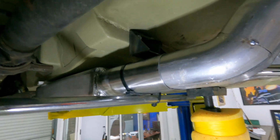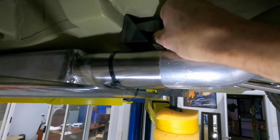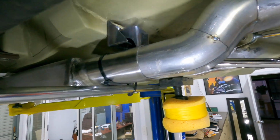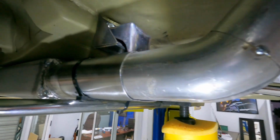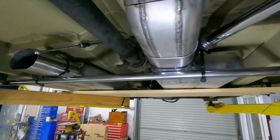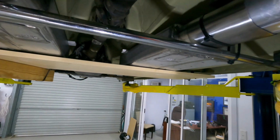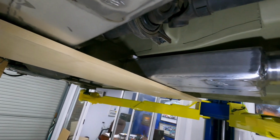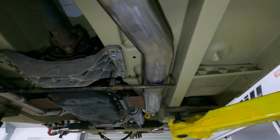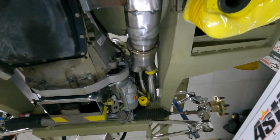And then the other piece fits in there, and that'll weld to the actual pipe. So it'll be pretty much encased, which will be nice. Probably powder coat those or something. And that'll be very solid, won't move around much because we haven't got a lot of tolerance everywhere. And then we've got spacer up in there to the floor. And then that pipe continues to run down along and up where I'm making the extractors.